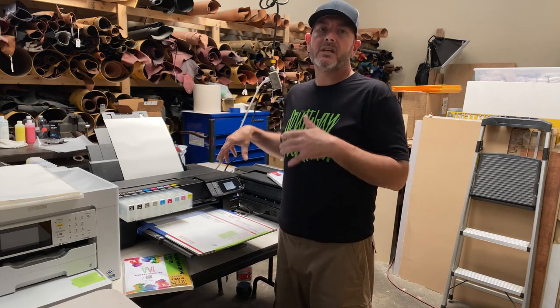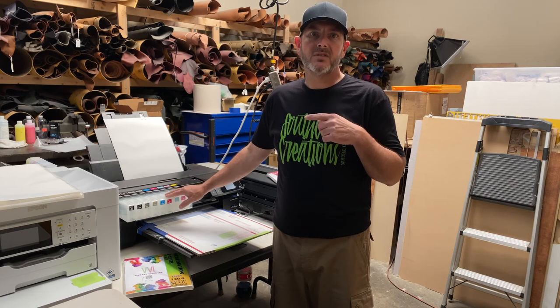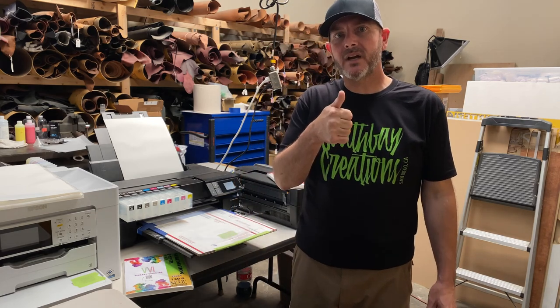Sorry if this is repetitive — I already have other videos that talk about this in more depth, a maintenance video and a cartridges video. But this is specifically for when you go on vacation or leave for more than two days. If you leave Friday afternoon and aren't back until Monday morning, just put the cleaning cartridges in, run those cleaning cycles, get the ink out of the head, and keep your printer in tip-top shape. If you start getting lines in your prints, it's because you didn't do the maintenance. Have a good one — like, comment, and subscribe!